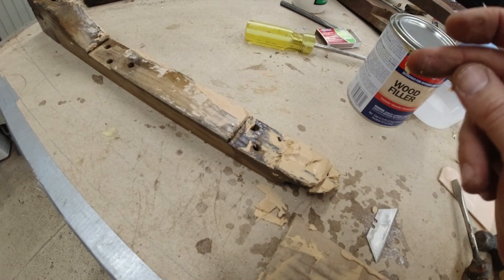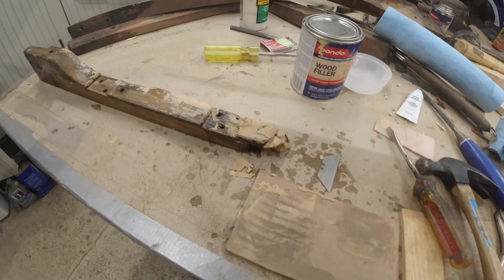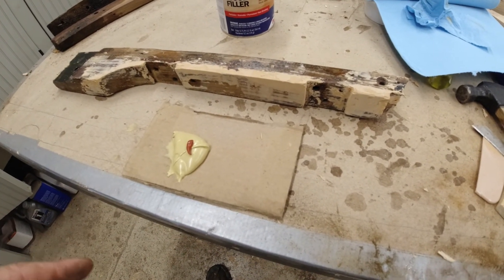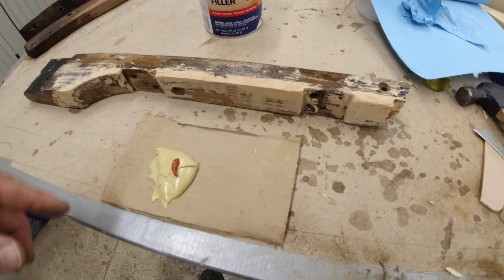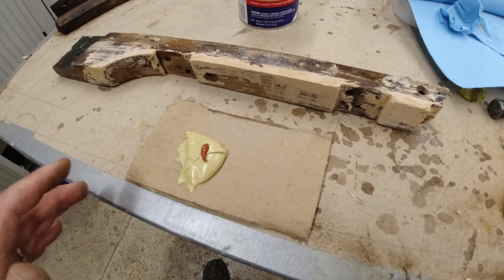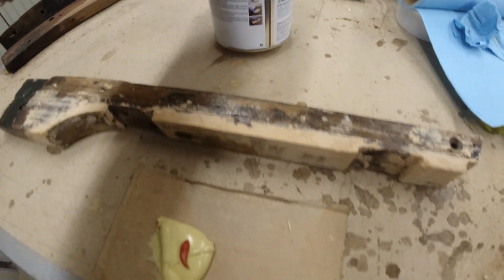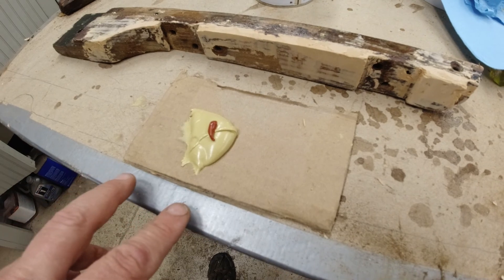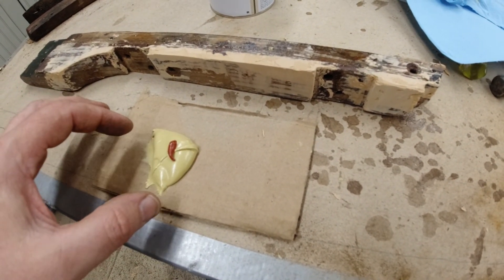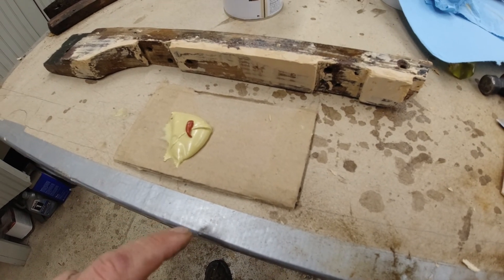I'm interested to see how well it drills, how well you can nail into it, how well it holds a nail and a screw — if it even does. Down to the last pass. One thing I wanted to point out: the directions say a three-inch circle, a half-inch thick, and then a three-inch line of hardener across it. But typically you mix these polyester fillers with the size of a golf ball and a half-inch line. This one ended up with a little too much hardener because I only needed about a quarter of a golf ball with a quarter-inch line.